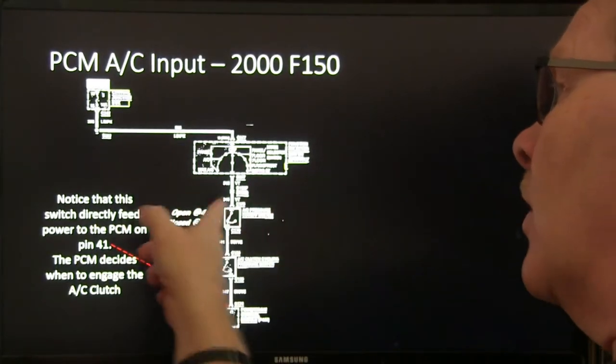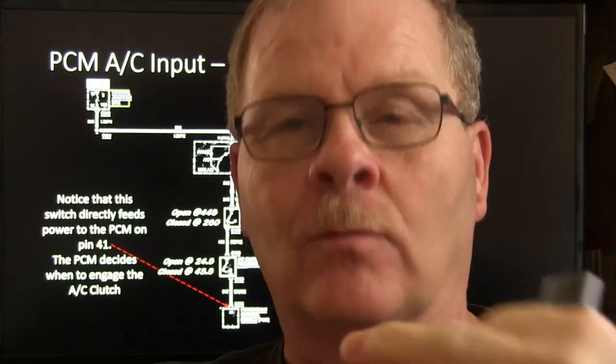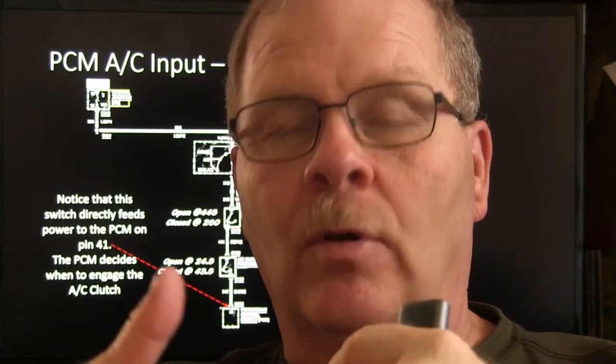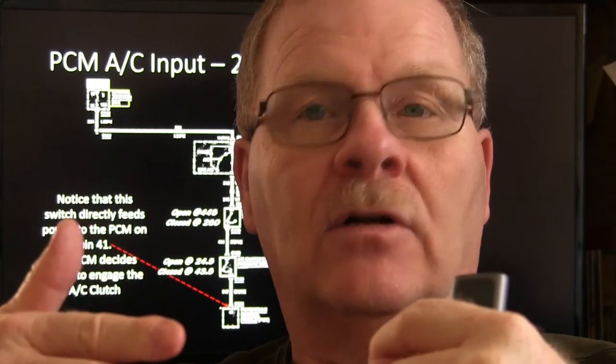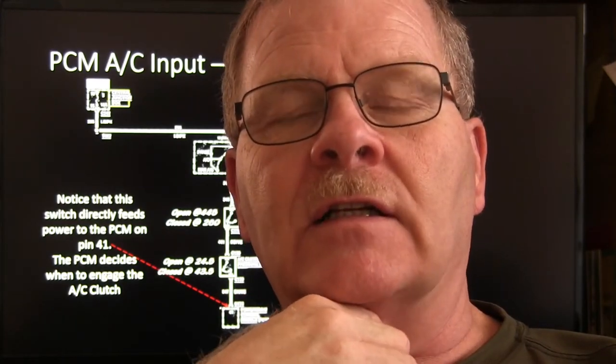That one right there will cut it off. Whenever you're looking at one, you need to make sure that if you're fighting one that doesn't cool right, you need to pull a radiator loose and tilt it back to look down in between the radiator and the condenser, because a lot of the straw and everything in these fields on these pickups will go right through the condenser and stop in front of the radiator, and that will keep airflow from going through there good.